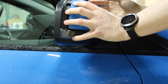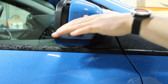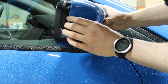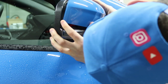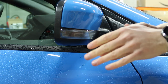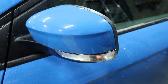Now we put the cap back on. The idea is to start it at the inner edge and get it positioned so the two clips at the bottom go into the holes, then go down and a little bit forward to get the two top clips to go back in — those are the same clips we loosened earlier. It's a bit tricky, so just have some patience and it should drop in eventually. There we go — the inner clip and both side clips are in, then we just push down and a little bit forward and the top clips click right into place.